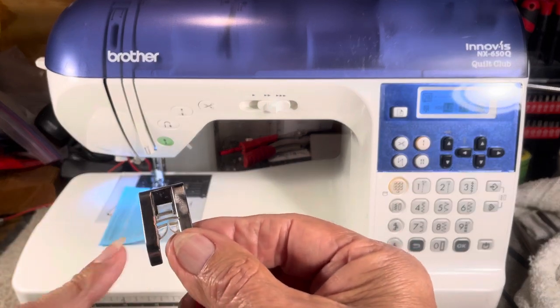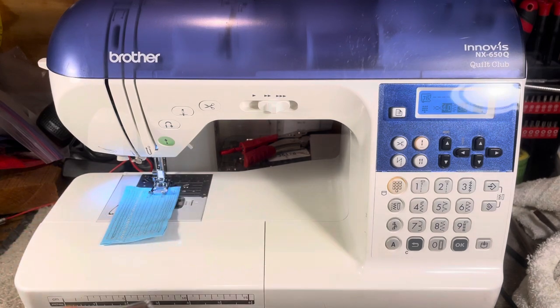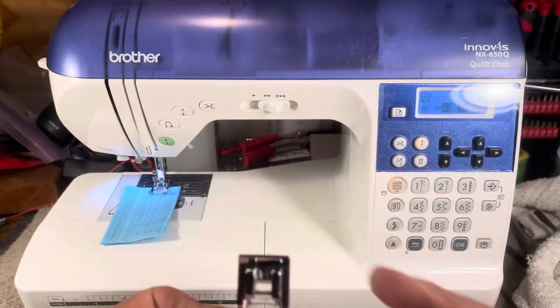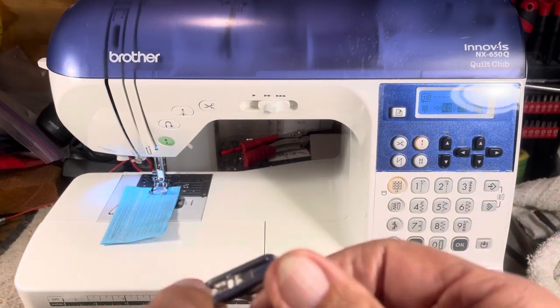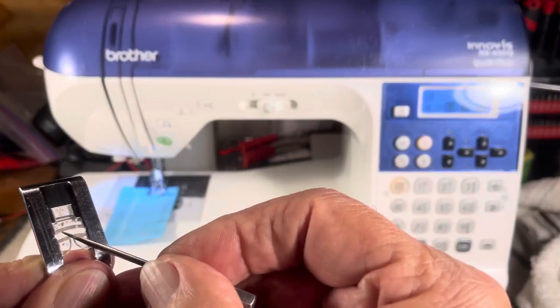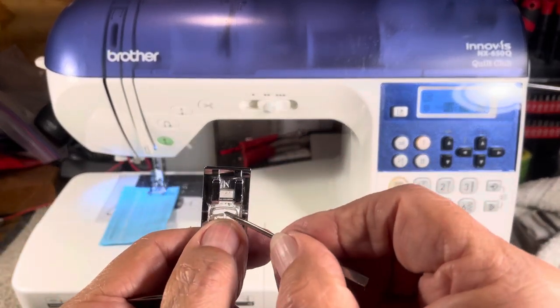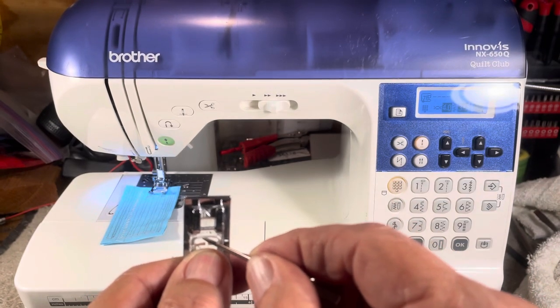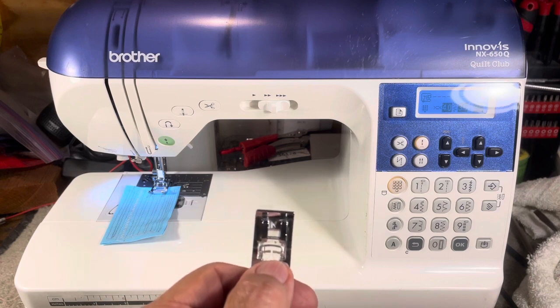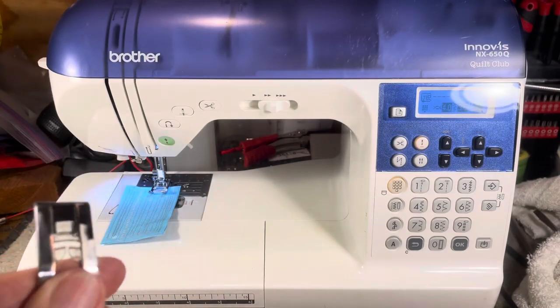I'm putting a new presser foot on here. I lined up the feed dog and set the feed dog height. See what the bottom looks like when it doesn't have grooves — absolutely slick. I made one pass on a polisher and already got it right down to the base metal. I'm giving her this one from a spare I had in the drawer from a machine I stripped. On the back, along the edge where the needle hit it, it was banged up badly — I left it that way so she can see it. She won't be happy, because she just paid big money to have this serviced and it was still feeding sideways. Had they flipped it over and seen this — eureka, it has to be smooth.